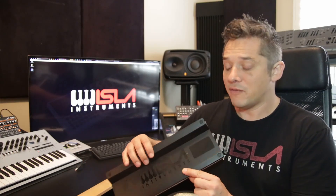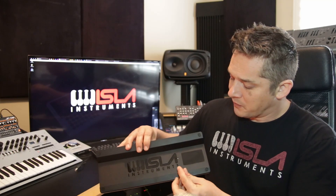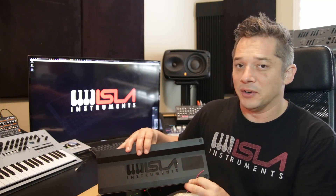One of the most important steps to getting the latest firmware onto your ChordBot is to place your ChordBot into DFU mode. DFU stands for Device Firmware Update. To get your ChordBot into this mode, turn it over and towards the end near the logo you'll see a small aperture, and inside there there's a push button.